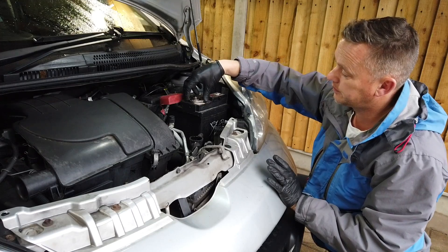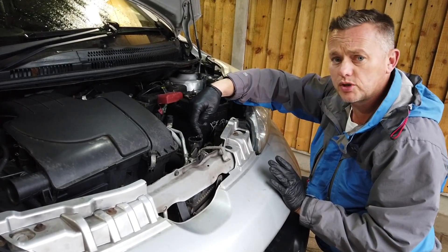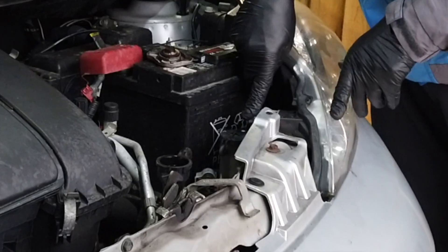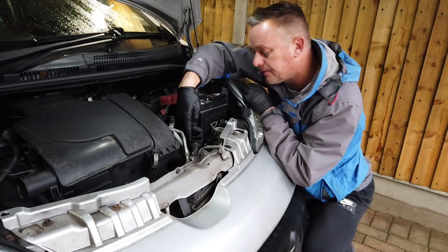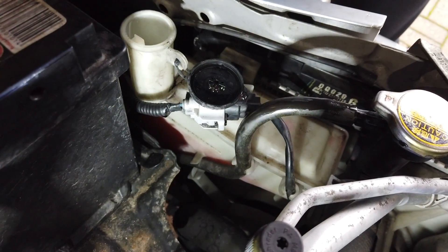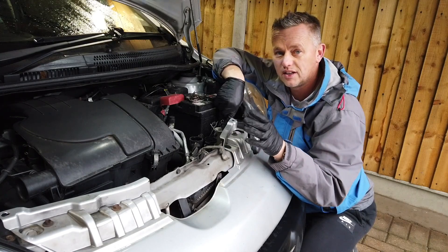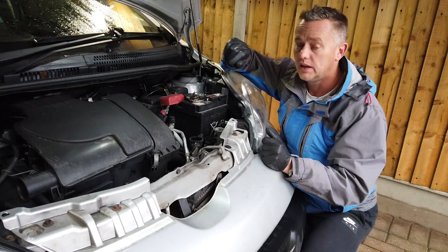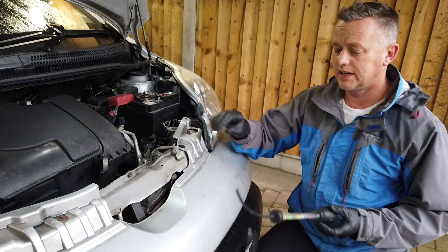You've got two tanks. You've obviously got the top one which is the pressurized system, and then this pipe at the top comes out and goes into this bottle over here which has another lid on it that says 'coolant.' If you pop that open you can just see the fluid behind the plastic. On the side of the bottle there's a minimum and maximum marking. We need to check the antifreeze content in this one as well, because although the two are linked, they're not directly linked.